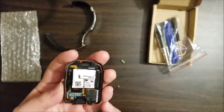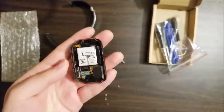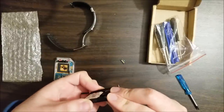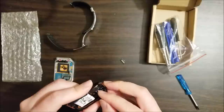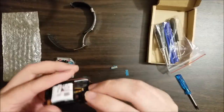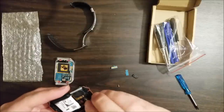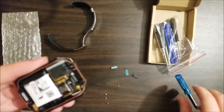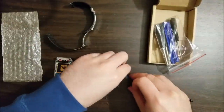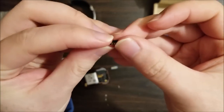The contacts are in here — I'm not going to poke it with something metal, that'll be bad. There's a speaker in here as well, which fires out these two holes in the side. Here's the little board that we actually need to replace. Should be able to just pry that out. Mine was actually stuck in, so it actually broke. Well, good thing I have a replacement. There's actually some sticky foam that we are going to want to keep in there. That just straight up tore on the one I just removed. Well, good thing it was corroded badly — I'm not going to be reusing this anyway.